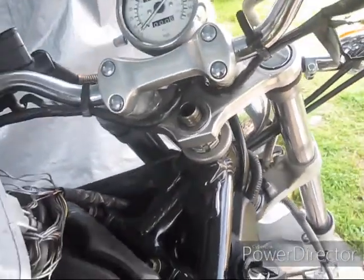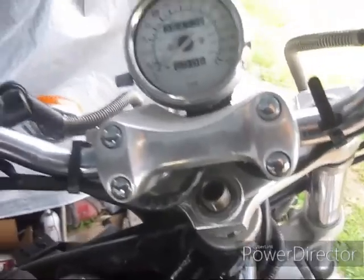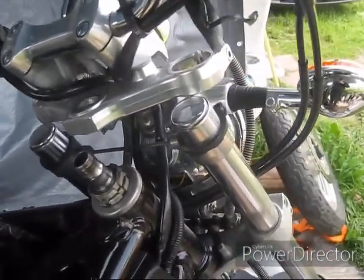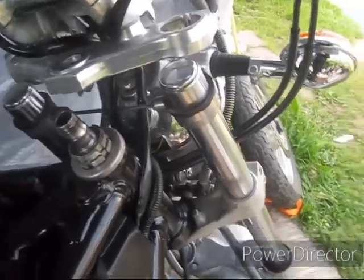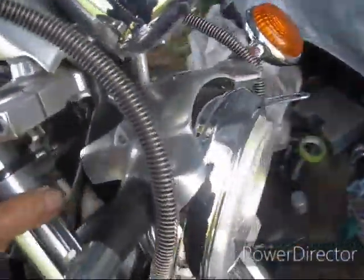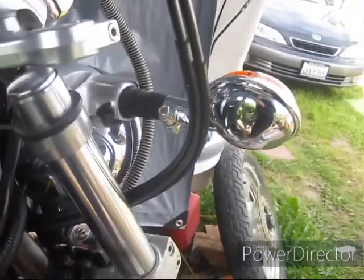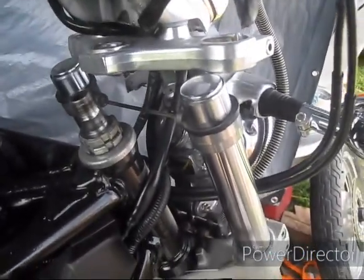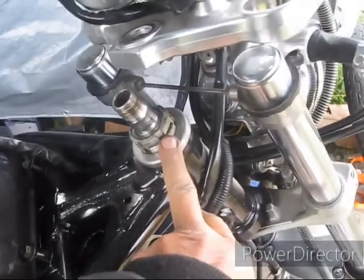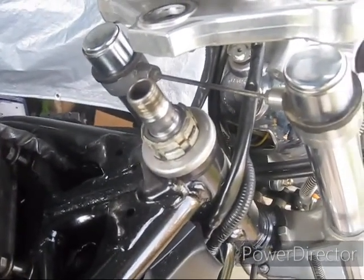Pull this big nut off of here. Yeah, see it's loose — I should be able to just pull it right off of there. That top triple tree just lifts right off of there. I'll have to take these things out. I think they probably just slide out. Looks like I can just take these two bolts — or nuts — here. There's a special tool to do that with, but I don't have one, so I'm just going to use a punch and a hammer to unscrew it.